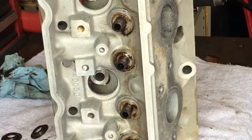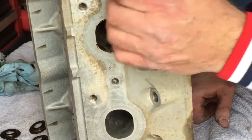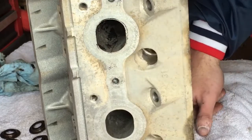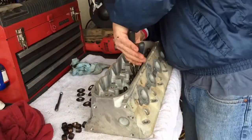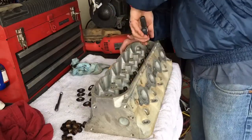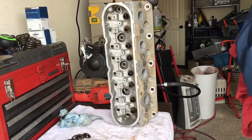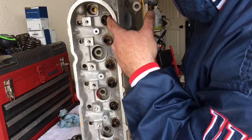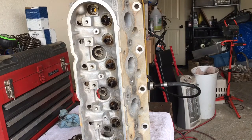Let's grab the other head. I wanted to point out that through the various oven cleaner washings, it almost completely cleaned out — 70 to 80 percent or more of the exhaust ports — which is a win, because that's really dirty porting when you've got to cut all that carbon out. We got everything disassembled and can start cleaning up the ports. You can see all that burnt gummy oil underneath those locators — a little moisture from the cleaning process was giving that suction on the locators, making them not want to come off.